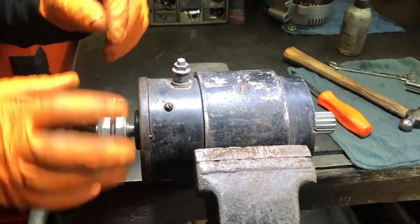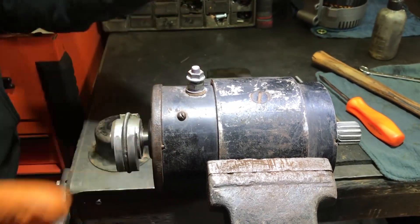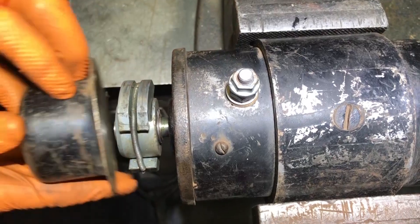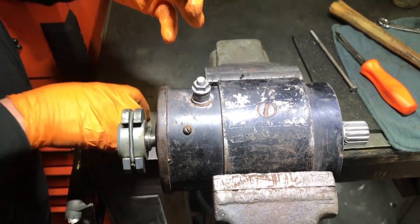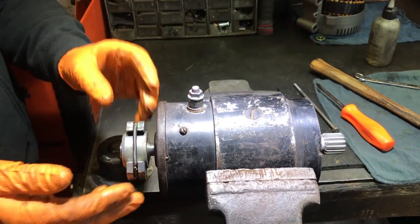It turns freely as the winch is pulling, but then when you let off the button to let the motor cool down, re-hook your snatch lines, or whatever you're hooking up to, it will fling these brake shoes out and they'll come out into this cover and help slow your winch down on the retraction. Otherwise, you can just blow up the winch motor because the load will just need to shift five or ten feet and it has destroyed your motor. So very critical.